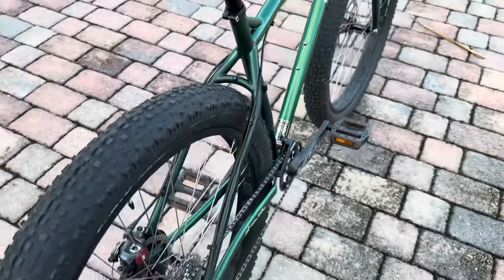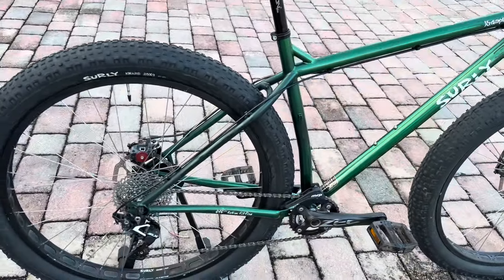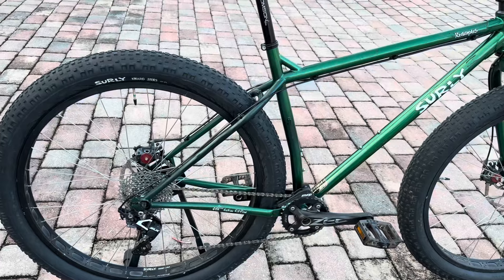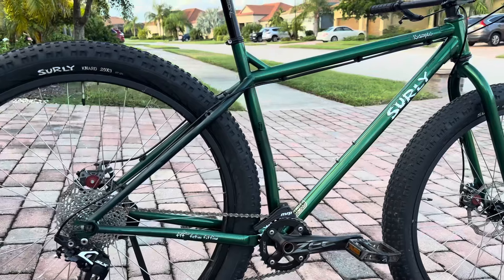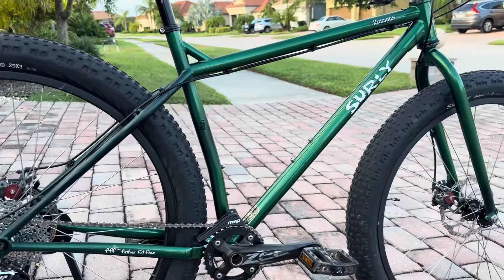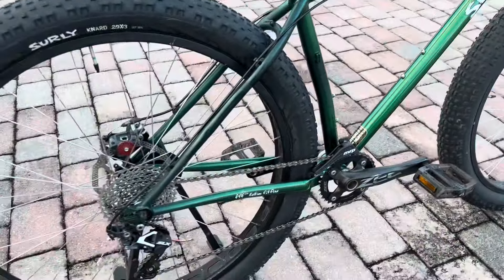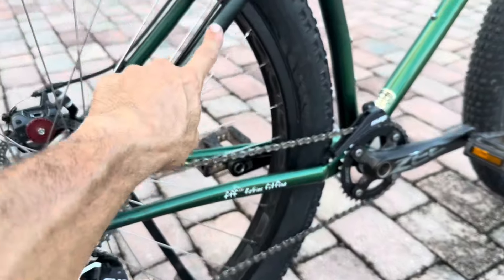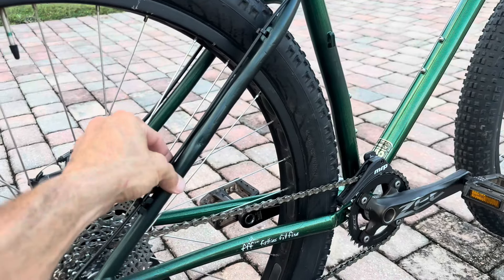But as you can see, I've been in the bike industry for 30 years and the saying in the industry is 'steel is real.' They say that because when steel actually gets bent or out of alignment, what's nice about a steel frame is you can kind of bring it back to life. It's not like aluminum or carbon where the frame is trashed, as long as the impact's not too bad. So what happened here was there was an impact to the stay right here which kind of dented the frame in and flattened this tube a little bit.